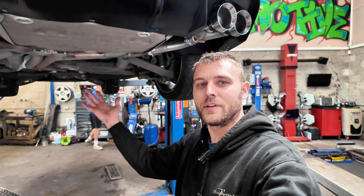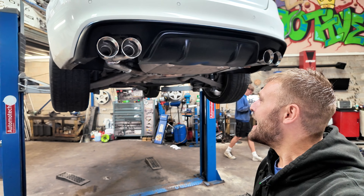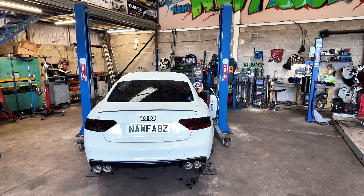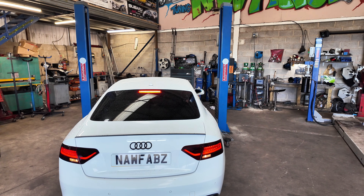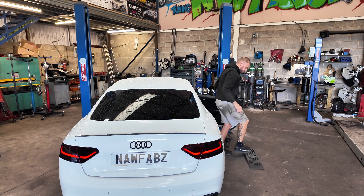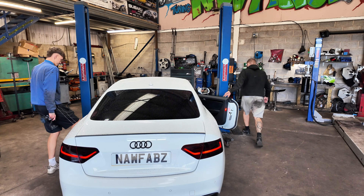I've made the decision - I'm going to go with the bigger tailpipes rather than the smaller ones, I just think they look better. But I have caused myself more work which obviously I can't charge the customer for, I'm going to have to swallow the cost. Usually when I do four inch tips I have some that are already on a Y split from the factory, but these ones are not on a two-to-one. So let's make two Y splits to get these two pipes into a single connection point on the car. First thing we're going to do is bend four 25-degree bends - bend it 25, cut it off, bend another one at 25, cut it off. We're going to do that four times.